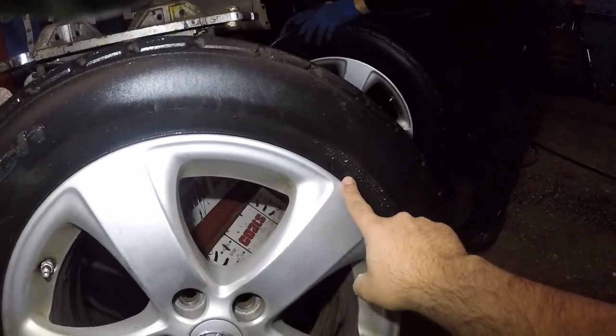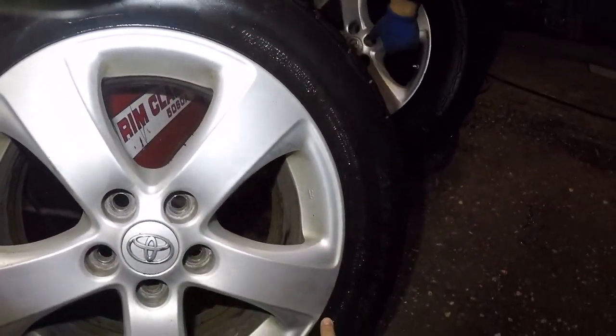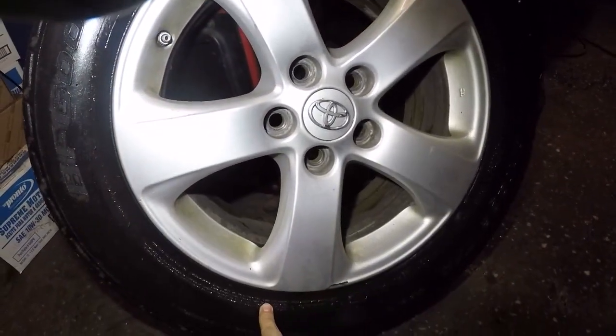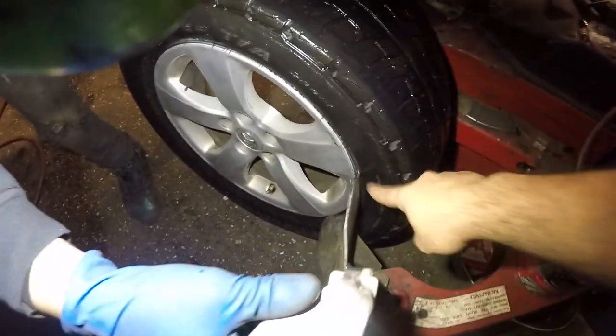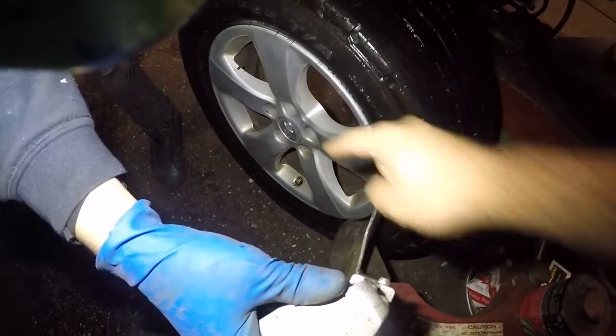To dismount this tire, you need to break the bead away from the sensor — from this angle here and here. You'll break the bead here and here. We're gonna show you that right now — we're gonna break the bead from right here, away from that sensor over there.